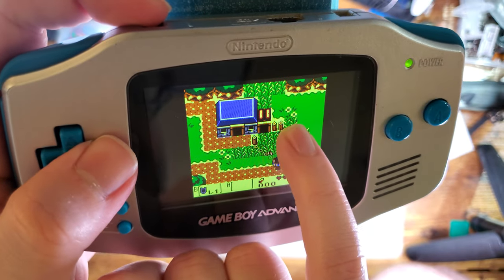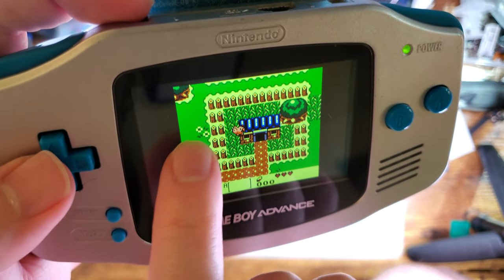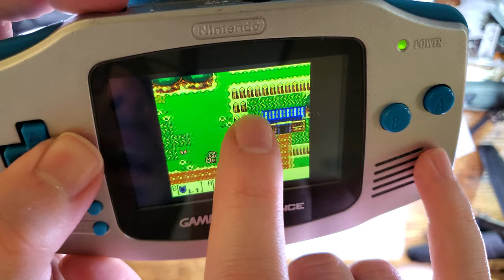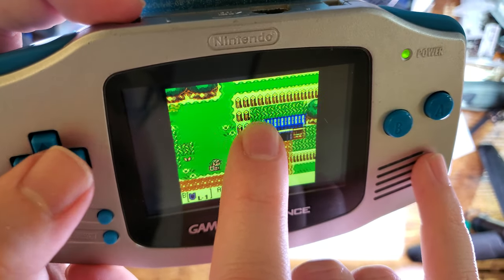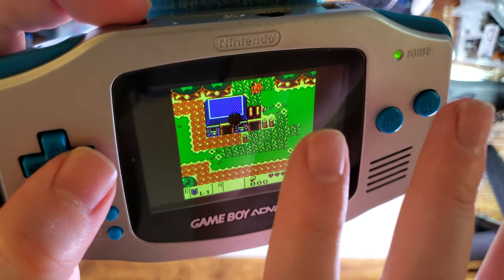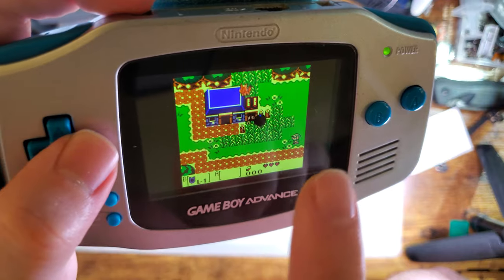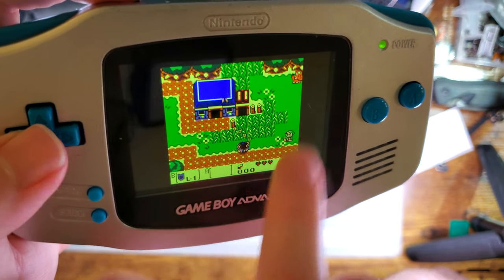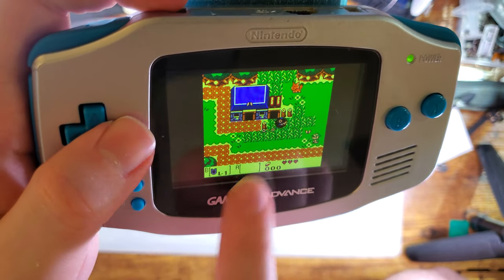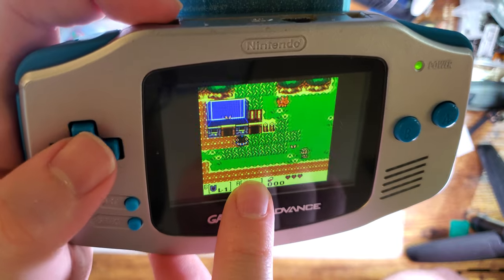The other issue was this green grass and these brown wooden posts. I don't know what it is about these two specific colors, but some of the older 9380 based backlight kits struggle transitioning between that color green and that color brown, and it results in some overshoot of the pixels themselves, so you'll see artifacting across the screen as it scrolls. The artifacting does disappear quite quick, like in less than a second, but it's there and it's noticeable and it looks bad. I don't see any of that on this kit. So the screen that they're using for this kit does handle that specific effect a little bit better. There might be some other color combos that trip this thing up, but I haven't seen any in my limited testing, and I haven't seen anyone report anything either. There's still time.